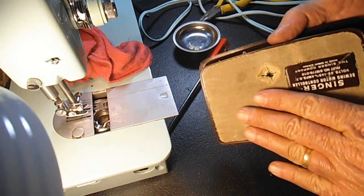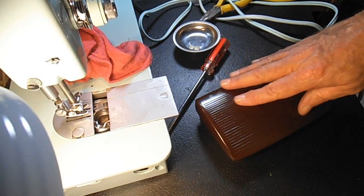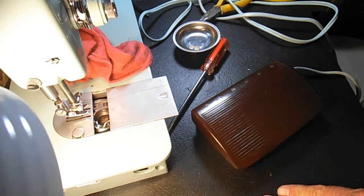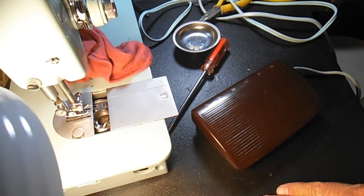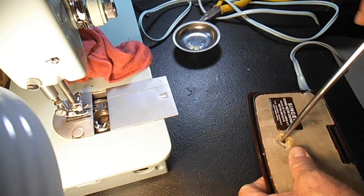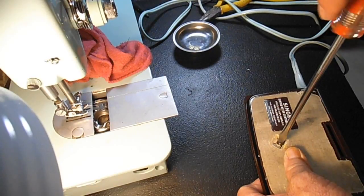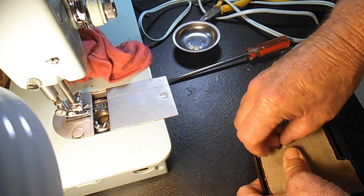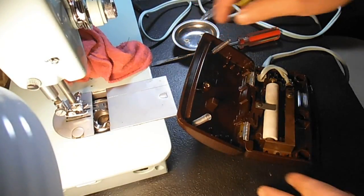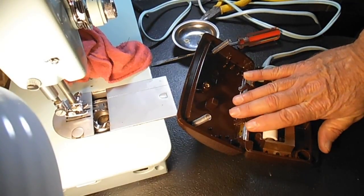I have let this sit for about 20 minutes, which would be enough time after running it strong for it to cool down normally. So it should be room temperature. Let me unplug it. If our adjustments are good, it should be room temperature. If we find it's warm or even worse hot, then we know we've got that adjustment screw too far counterclockwise, and it's letting current leak through the carbons. So let's find out. Here we go. Nope, totally room temperature. Not warm at all.